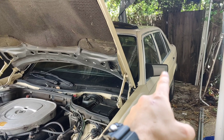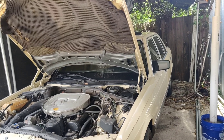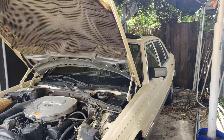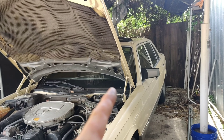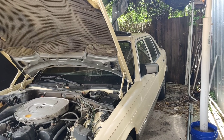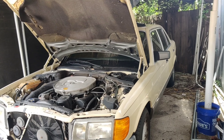Coming in the near future, there are a couple things wrong with the windows. The front windows — I believe I need to change out the motors. For the rear window, there's a bracket that's basically a riveted piece that goes on there — I ordered in the new pieces and I want to do a video on that. We're going to be replacing that part in the rear window because the rear window works fine — the regulator and motor are working — it just won't go up and down because the arm is freely moving and not connected to the bracket.